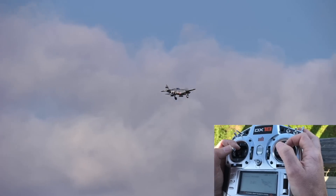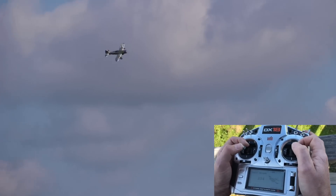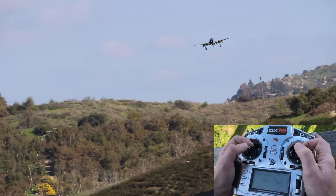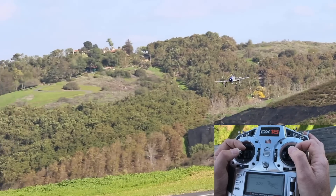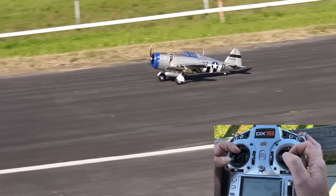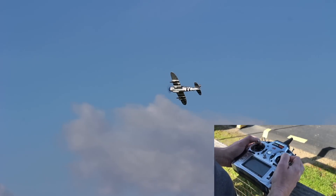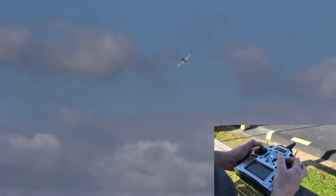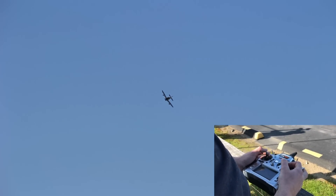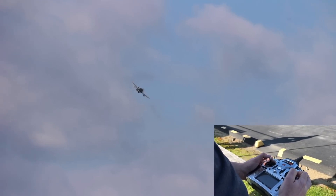This way, simply put your gear down to use it and gear back up when you don't. You will be locked into having SAFE on for takeoffs and landings, which isn't necessarily a big deal since you don't need large stick movements in those phases and that's usually when you want the most protection — being the most critical phases of flight. One thing to note: the pitch and roll angle limits with SAFE Select are actually a function of the amount of throw you have programmed. The higher rates you have selected, the higher angles that SAFE will limit you to. So flying with higher rates while having SAFE on will help maintain the feel of the airplane around center.